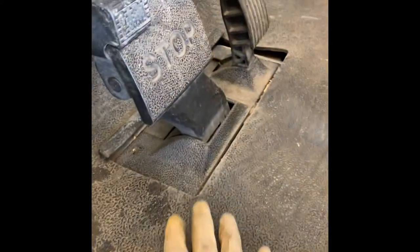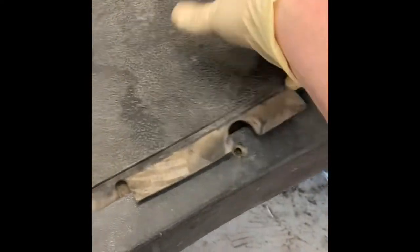With the floor mat back on, tuck the edges underneath the cup holder. Position it over the pedal assembly and push it all the way underneath to the other side. To get this portion in, pop your rocker panel out and slide it underneath. Slide it back into its spot on both sides and snap it in. Once both sides are popped in, you'll see the hole right there — take the hardware you saved when you removed the floor mat and zap it back in. Now it's time to run our wires to the back.